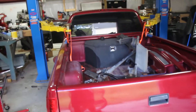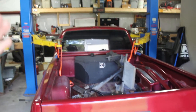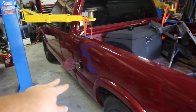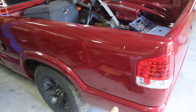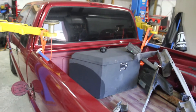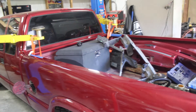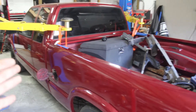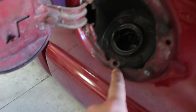As you can see behind me I have the truck with the bed bolts already taken out — I have six out of eight bed bolts taken out. There are two in the front in front of the fender well, two in the rear behind the fender well. I have the two in the front and the furthest one forward in the rear taken out, and then I loosened the rear ones so it can pivot back. I already have the lift here in position with ratchet straps connected to the hooks on the front. I also disconnected the fuel filler neck — that's just two bolts and a little clip at the bottom, so not too bad.